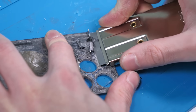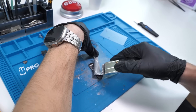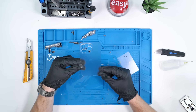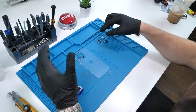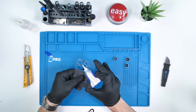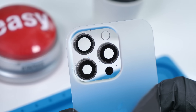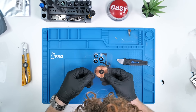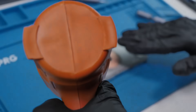Now it's time to do some scratching — there's no better way around this as far as I know. We just have to take a razor blade and scratch off all this paint very slowly and painfully. We just finished scratching off all the leftover paint and this thing looks beautiful — a nice matte texture with the Apple logo being completely transparent. We still have to find a way to connect the camera bumps to the back glass, since the aluminum we removed was doing just that. We'll use some super glue around the perimeter of the holes for the bumps. This won't be visible so it won't affect the look. Then we'll reapply the MagSafe magnets, reinstall the wireless charging coil and the flash, make a few final touches, reinstall everything, and reheat the adhesive so it's sticky again.